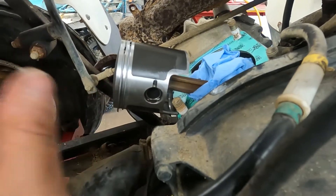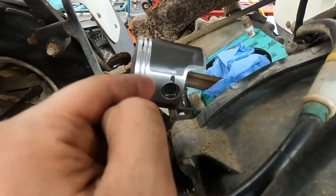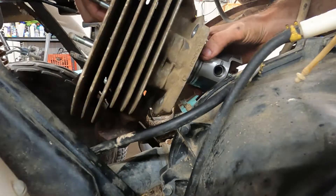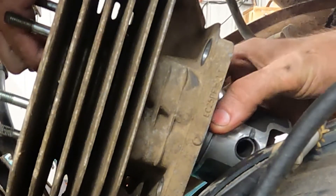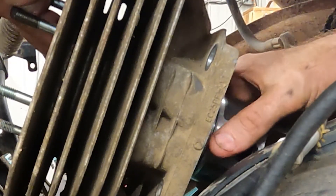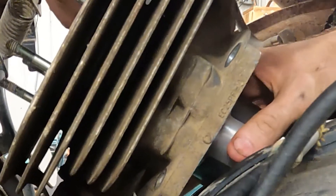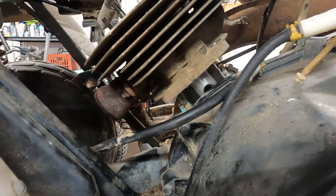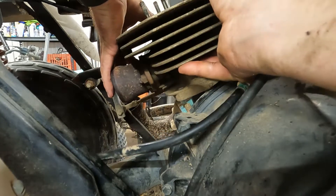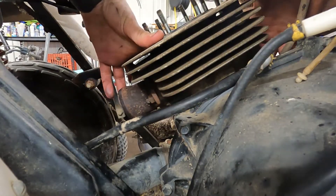I've seen them grind like an eighth-inch groove the same width as that wrist pin all the way up and down the cylinder — then you're definitely SOL. I've got my locating pins for the rings towards the intake where it should be. I'm going to get this circlip in, then slide the cylinder over, get the rings lined up on the pins, grab my cylinder, wipe a little oil in the bore, and we're just going to do one ring at a time. Once it's started you can kind of push the cylinder down. You don't want to twist the cylinder too much because the rings could open up in one of the ports.